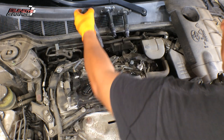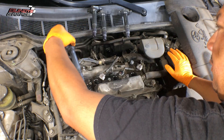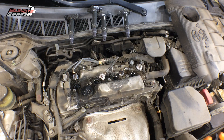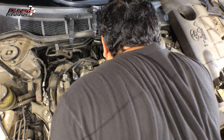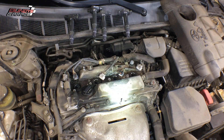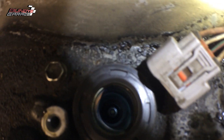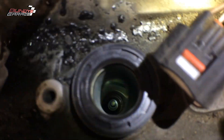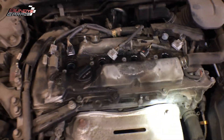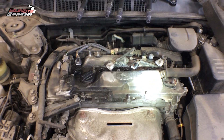Putting the coil packs up on the fender. Just wiggle the coil a little bit and it'll come up and out. Now I'm going to look down there and see if I see any oil — it's all free and clear. If you did see oil down there, it means one of your spark plug tube seals is broken. All four wells are clear. Sometimes those fill up with oil and the cause is a bad spark plug tube seal. If we do the valve cover gasket, we'll be changing those out as well.